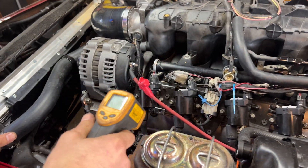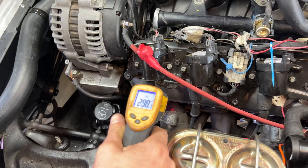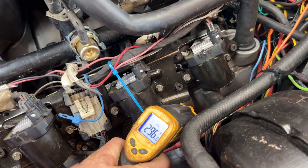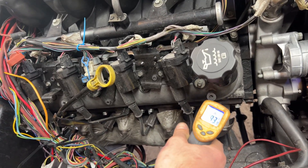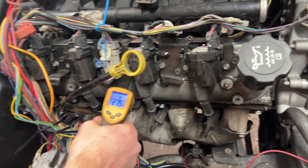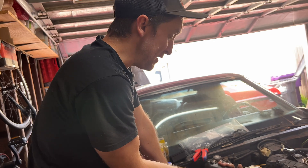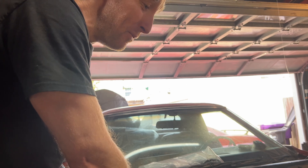I'm going to use my little thermometer here and make sure I got heat — an even amount of heat. Two — about 280. Three — about 300. About 300 and a little less. 300. 360 — ooh, that's high, but this one's not shielded so I wonder if that affects the reading. I can't really get a good reading, but as long as I get good heat out of all of them. I feel like it would be significantly less if we were getting a misfire, missing one cylinder. It would run a lot worse than this.